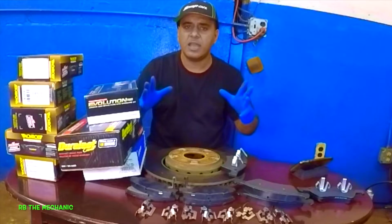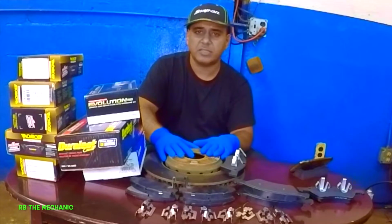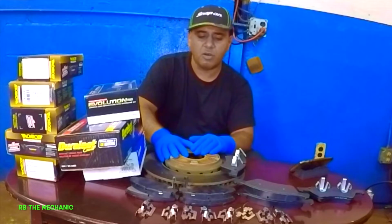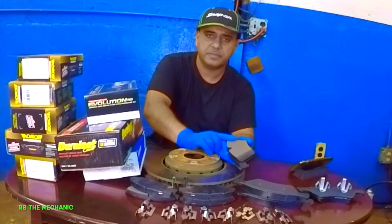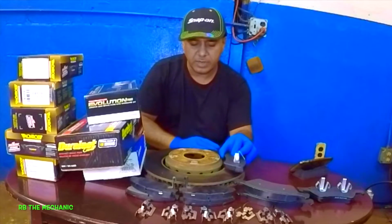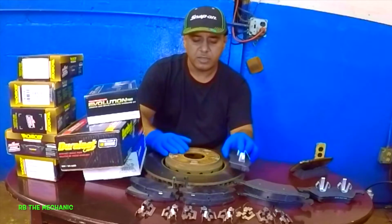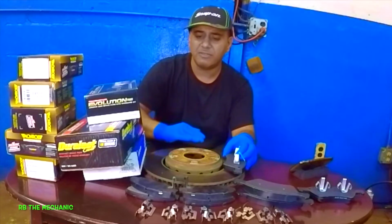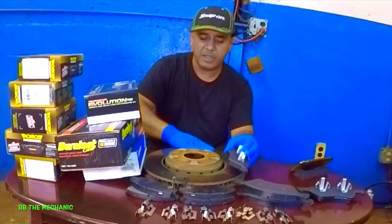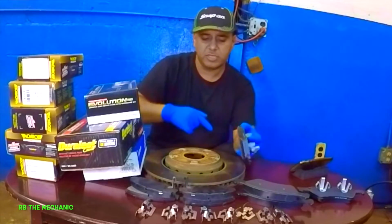So if you have not been doing that, you have been doing your brakes wrong all along, and you could do the brake job as perfect as possible, but if you don't break the brakes in, you're not gonna get a good result, all right? So I'm gonna bring my camera closer, and I'll show you the surface on this brake pad here, all right? There's a surface here that lets you break the brake in, and then this surface has to meet the rotor properly, and it needs to break in evenly, all right? This surface needs to break in evenly. That's what we're doing, trying to make this brake and the rotor break in evenly, and they can sit together and they can meet, all right, and become mates. And a lot of times if you don't do that, you're gonna have brake squeal, brake pulsation, the rotor's gonna go bad, a lot of things are gonna happen. So let's bring the camera closer and you'll see next.